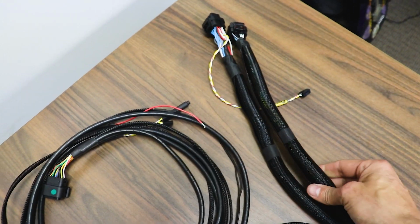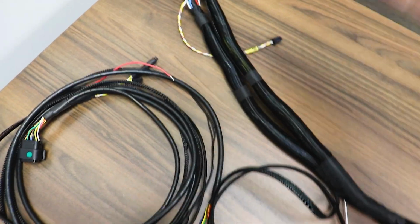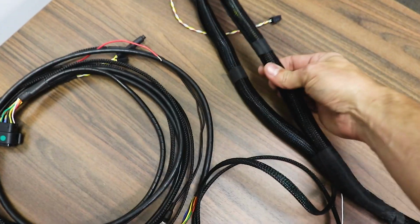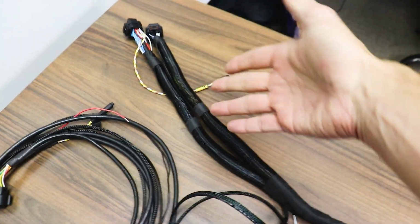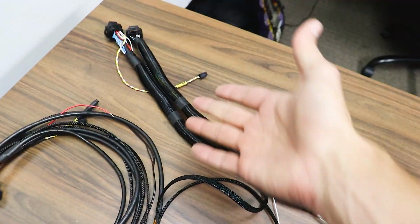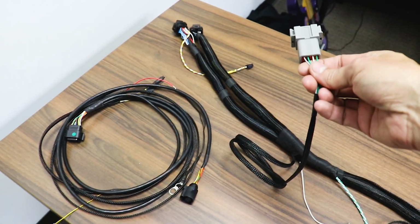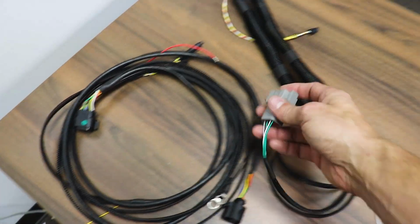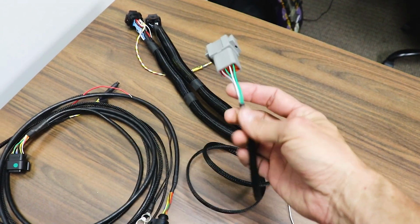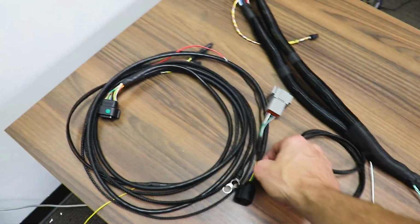At the moment, it just has that kind of wire organizer on it, which I'm glad I did it this way and didn't do a heat shrink of some sorts, because I've undone this at least 2 or 3 times to fix something because I forgot something. Like, for example, this little harness here goes to the fuel pressure sensor as well as the fuel level sensor. Need to order some more 4-pin connectors. That's all I had, but it will work.